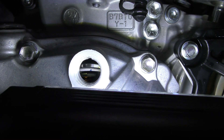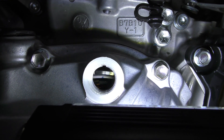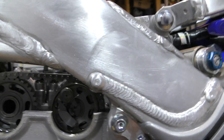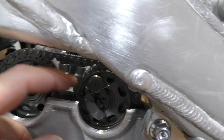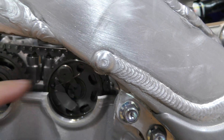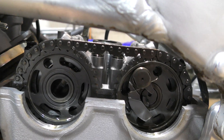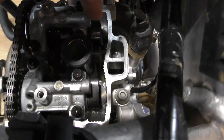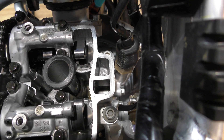I've got my marks aligned. I don't know if you can see that little arrow in there pointing upward toward that notch — that indicates top dead center. On my camshafts, I've got a mark right here and right here that line up with the top edge of the cylinder head. So when those two are lined up and I'm at top dead center, all the cam lobes are facing upward. That's the position I need everything to be in to measure the valve clearance.